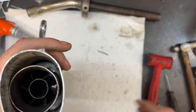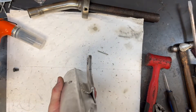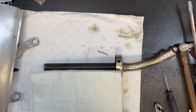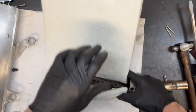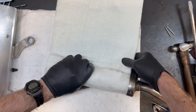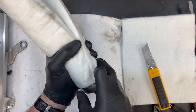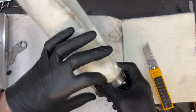All right, that's the core. It's not in there perfectly centered but that doesn't really matter — it's going to do its spinny spark-arresty thing that it's supposed to do. This perforated core is going to end up just mating inside of that hole there. Gloves on. I'm just going to roll it in there — there's lots of debate as to whether you should have it as tight as possible or loose and fluffy. I like putting it tighter rather than looser. You're not going to get quite as much sound damping, but your material is going to last a lot longer.